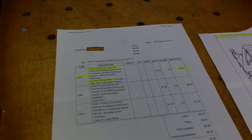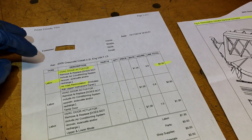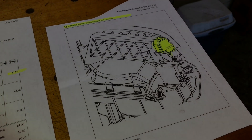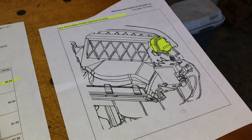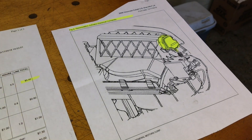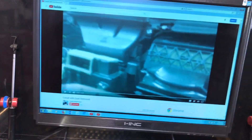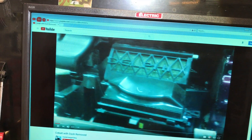The book says it takes 5.5 hours to replace the recirculation door actuator, or inlet recirculation. It's located behind the glove box on the right side, very top side. It's really hard to see, really hard to get to with the foam insulation. You can't even put a hand in there. People have actually taken the whole dash off just to get to it — that's what it takes — but there is a nice shortcut.